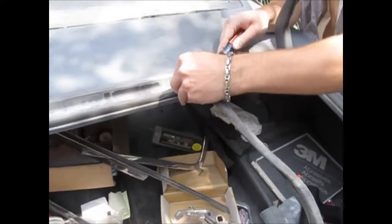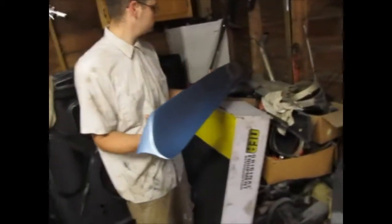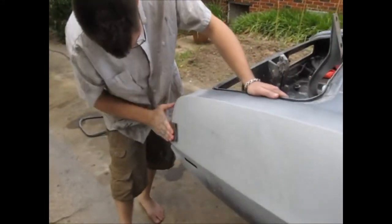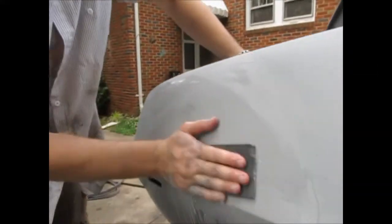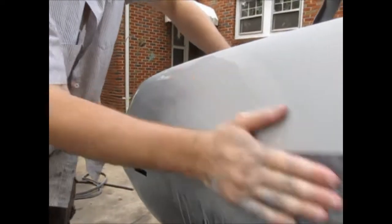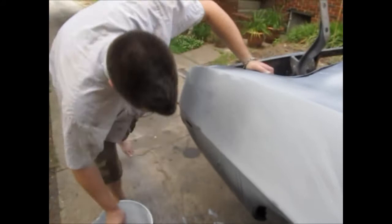Here's a preview — that's how the whole car is going to be looking. I put an extra coat of primer on this side here, just trying to use some up. Now we're wet sanding it down, trying to make sure it's very, very straight. This was the side that was really bad — it had a big dent in it. Pulled it out the best I could.